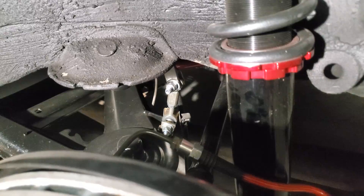That's it for the rear — there's not much adjustment you can do besides setting it up correctly. Unlike the front, where you have three holes on this Ireland Engineering setup to choose from: soft, medium, and hard for stiffness in the front. Let me get the wheel on and let's move on to the front of the car since the rear is done.